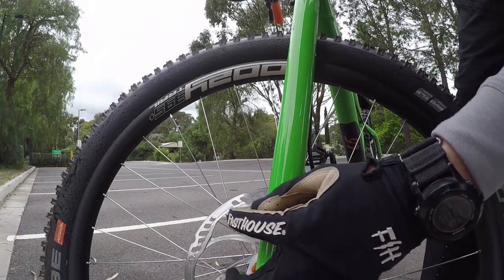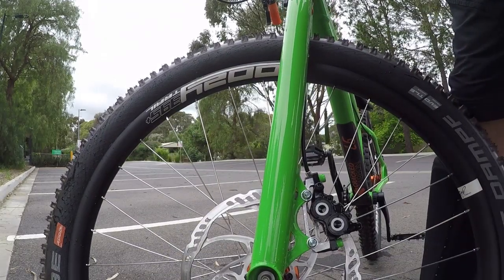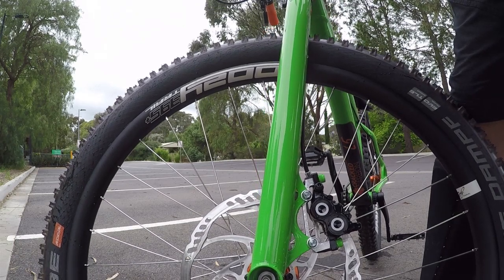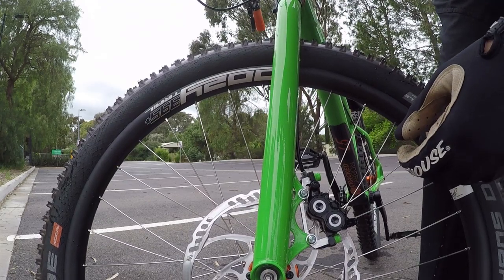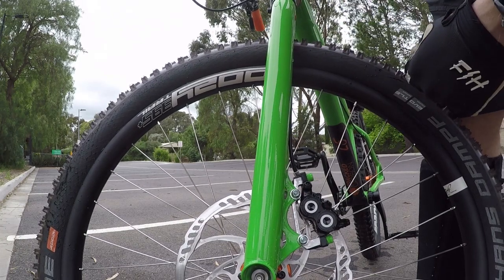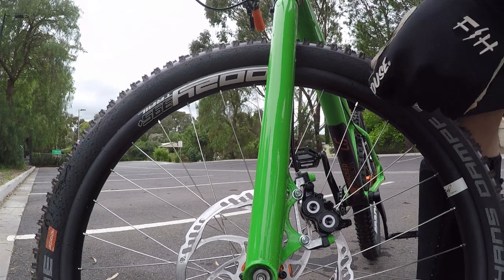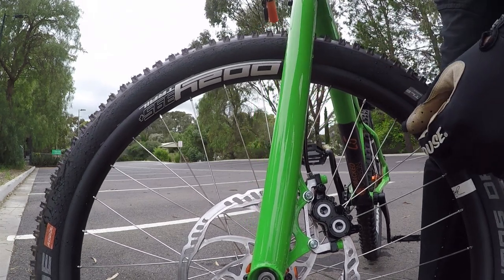If we have a close look at the rotor, those little sideways marks are starting to wear off and it's starting to level up. Slow and steady and it'll get there. A bit more riding as well — just normal riding. If you're into downhill or enduro or whatever, that naturally burns them off, gets them hot, gets the pads level. Trials not so much — there's more on-off braking, they don't really heat up much, so you've got to spend a bit more time doing this beforehand.